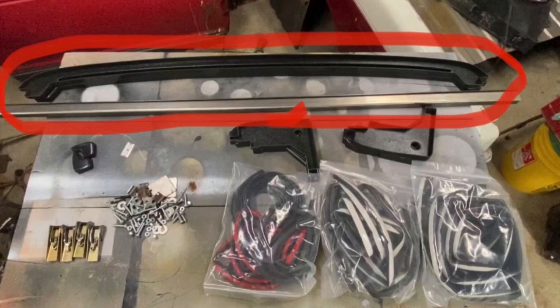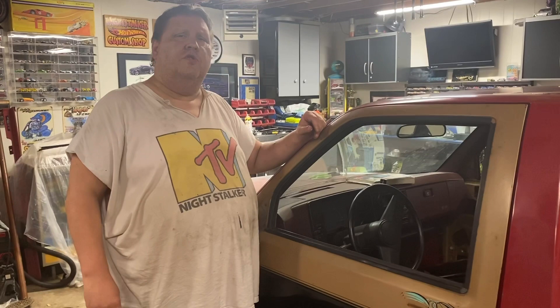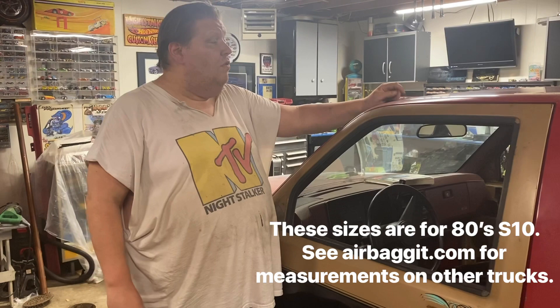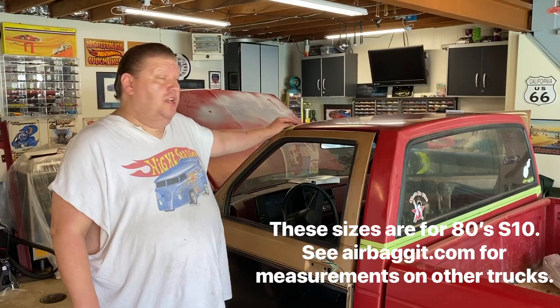We're going to mark our kit for the first top line for the bows that go across the top of the roof. Note: the sound on this video was lost but we'll narrate what's going on. We're getting ready to mark our line for the top cut right behind the windshield. I'll lay down green masking tape so you can see the line better. For the first cut, you measure from the top of the windshield back four and three-quarters of an inch and draw a line across. After that, you measure beyond that three-eighths of an inch to compensate for the thickness of your convertible top kit, then draw that line.